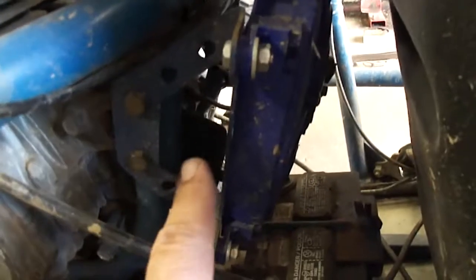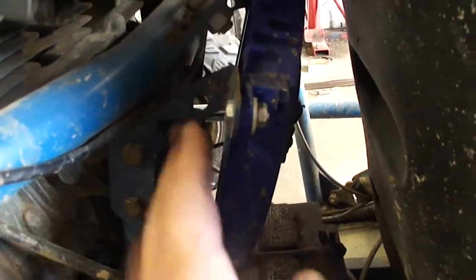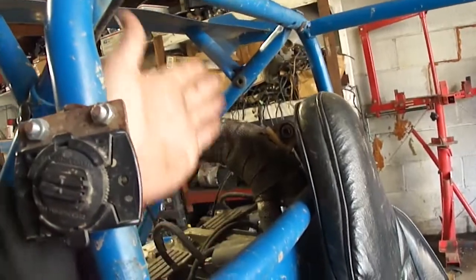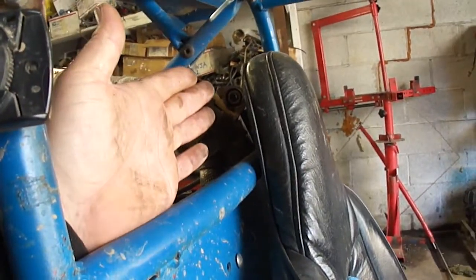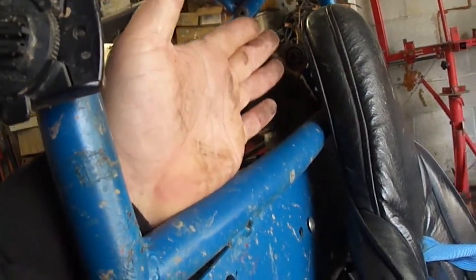I do have a bit of a space issue back here. You can see there's the oil filter right there. So there's not much room in between the fan and the engine. I would like to put the oil cooler back here. Ideally, you'd have it up here directly into the wind, but the problem with that is right there is the front tire, and it will launch rocks at the oil cooler, and I don't really want to bust my oil cooler out on the trail.